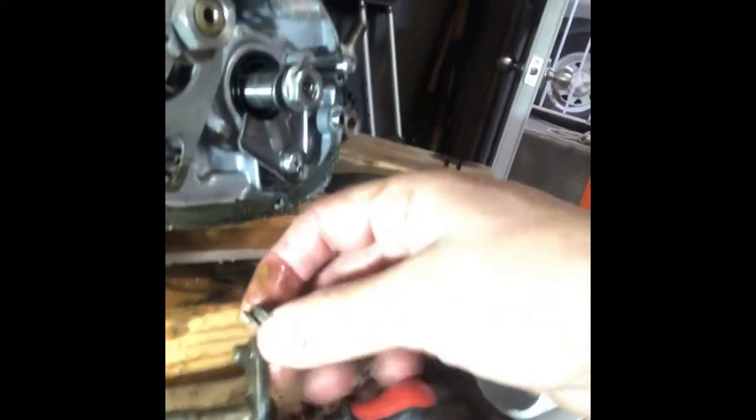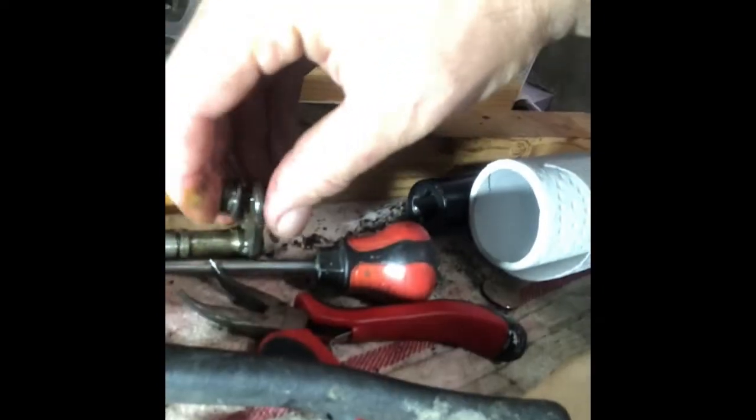Okay, so making note of, on the shifting lever there's this little bushing to fit inside this, right? So I'm going to stick that right on there. Now I can just take this shifting lever and set it right over here. Now we're going to try to work this off. Wow, that does not want to stay on the wood, because the crankcase is in three pieces, right? I'm making it narrower and narrower as I keep taking stages off of it, so it gets harder and harder to stay on these blocks.